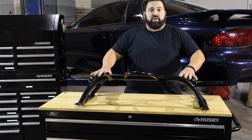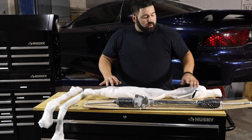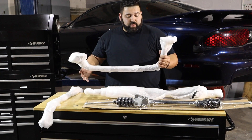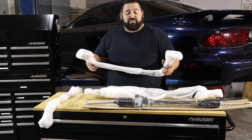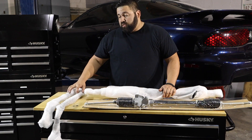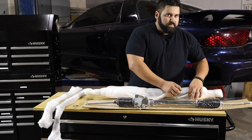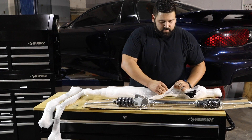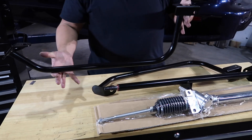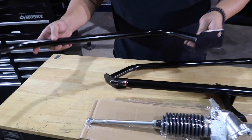What we have laid out here is going to be our Pinto rack, the chromoly steering column along with the steering shaft that we have to cut down to fit once it gets fitted to the car, and the crash bars. Basically, if we do end up doing a wheelie and come down, these hit on their knees before anything else on the front end, saving the belly pan, the oil pan, pretty much everything underneath the car — just a little bit of extra insurance and easy to replace. These are going to mount up underneath the k-member so in case of a wheelie they get bent and are easily replaceable, saving a lot of parts on the front end.